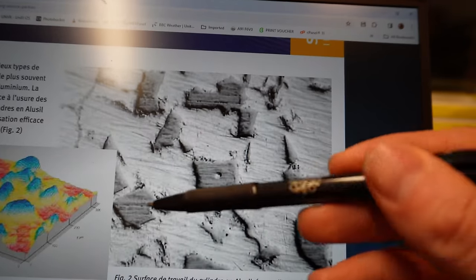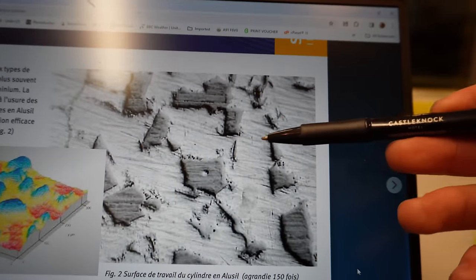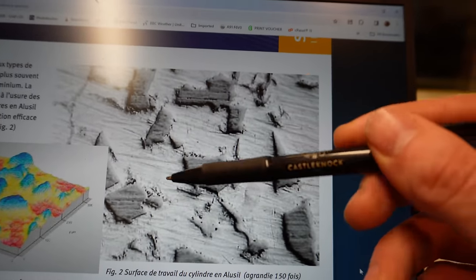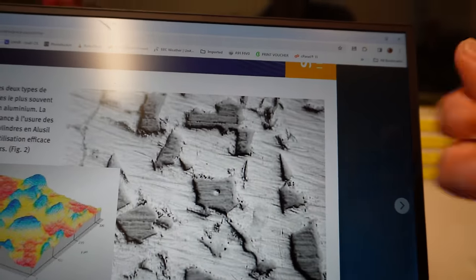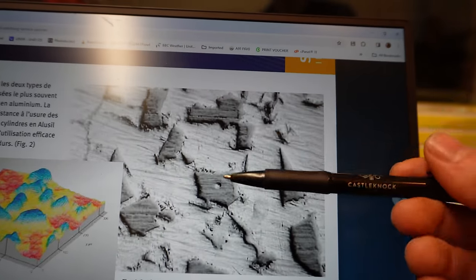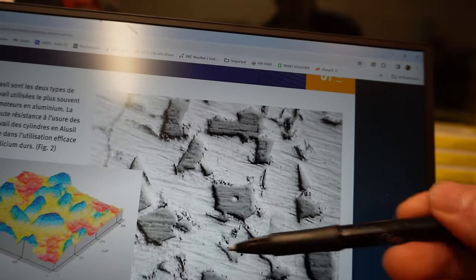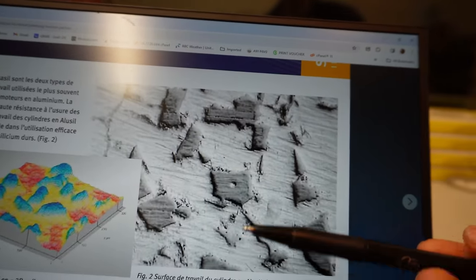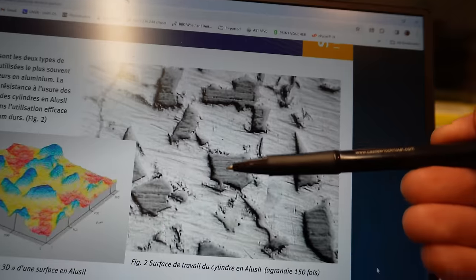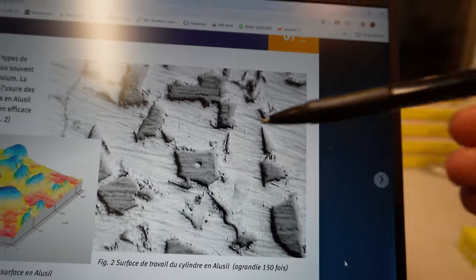These light gray spots are our silicon crystals, or silicon islands, and they're impregnated in this light gray surface, which is our cylinder wall. This is all aluminium, but the crystals are brought to the forefront after the honing process. That's the final finishing stage, whereby these are left proud of the aluminium, and it's upon this surface that the actual piston rings ride. There's a layer of oil that surrounds these crystals and runs across the face of the crystals, and it's on the oil that the rings run, but if they do contact the cylinder bores, it's this really hard silicon crystal that they engage with.